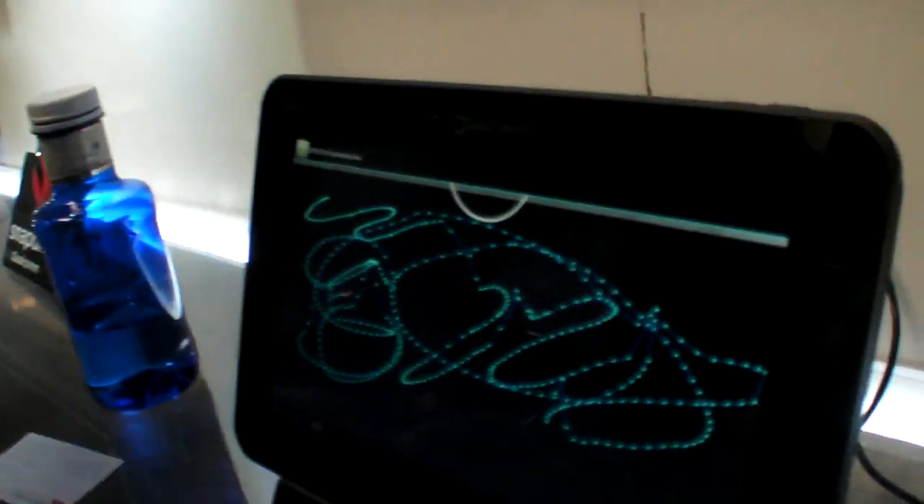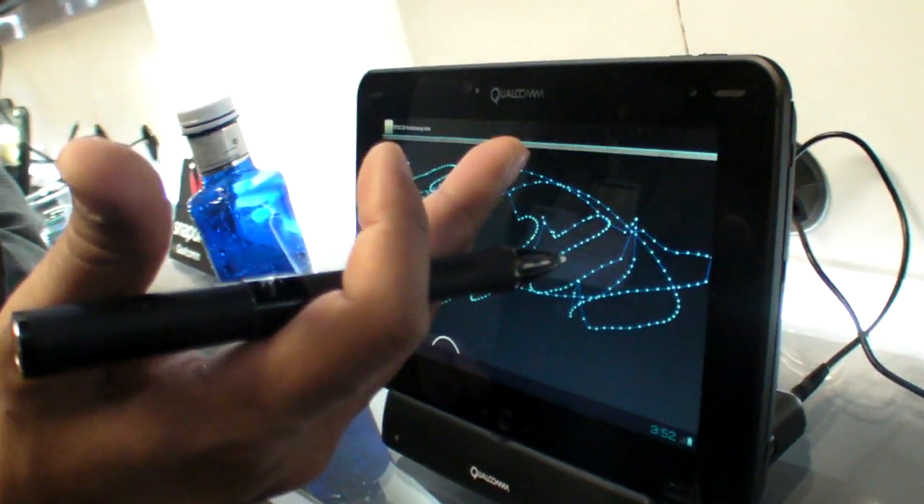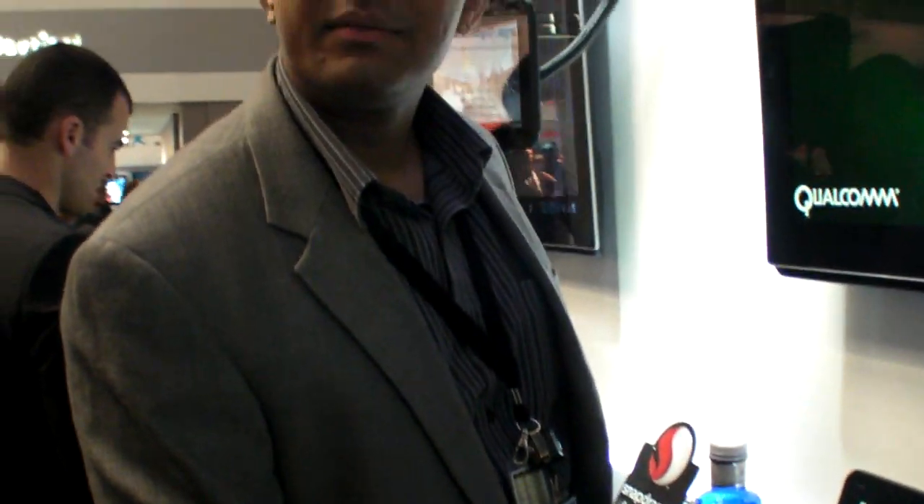The sensors are primarily three to four microphones — using four microphones to do triangulation. Right now the processing is done on the CPU, the Krait, but we are planning to move this to the DSP to leave more headroom for applications on the CPU side. When OEMs get the Snapdragon S4 software, all of this comes pre-integrated and they can enable it on their devices.